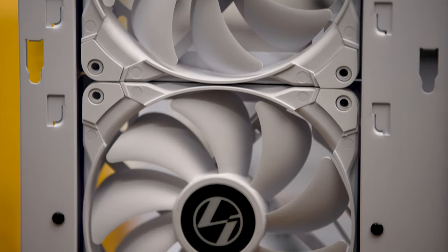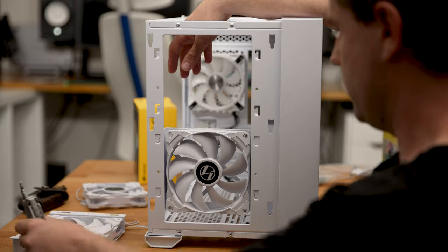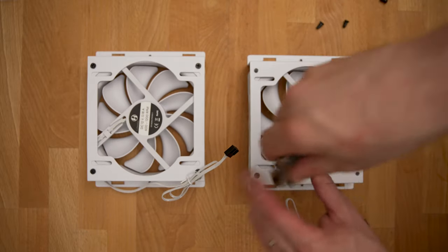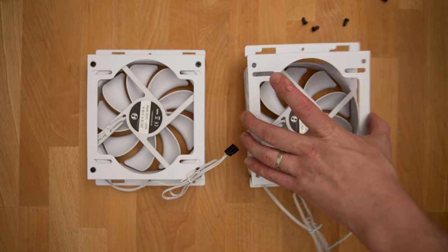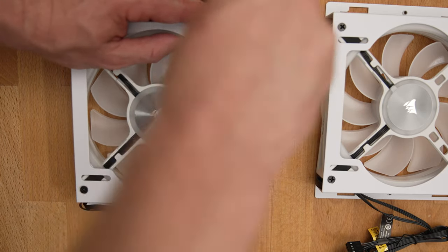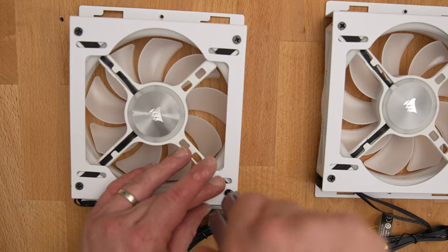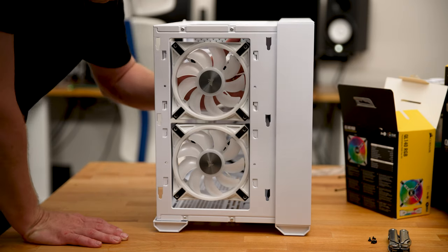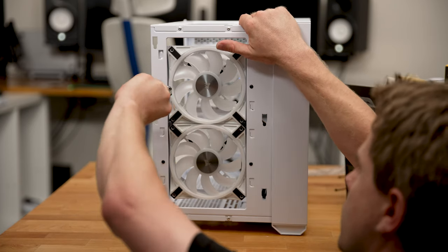With that out of the way, you'll see four little screws — two on each side of both fans — which you'll need to remove in order to take the bracket out. Just go ahead and pull them up and take them out. Once you get the fans off, you'll see that each fan is also secured to the bracket by four more screws which you'll need to undo to remove them. These front fans we're going to be installing as intakes, so make sure the open side of the fans are facing outwards while the grill side is towards the inside of the case so you can pull some nice cool RGB-infused air inside. Once the new fans are screwed into the bracket they should just slide back into the case. Make sure you do the bottom one first as you won't be able to put it in if you do the top one first.